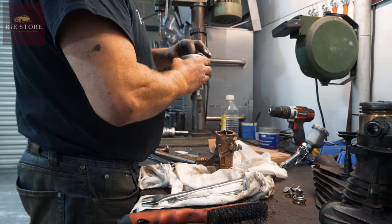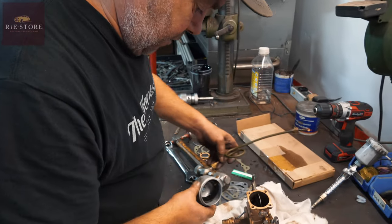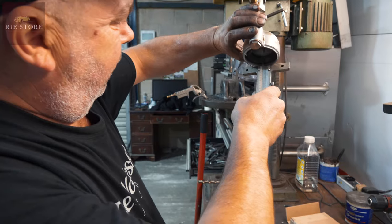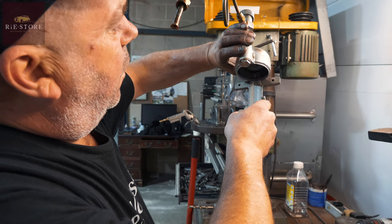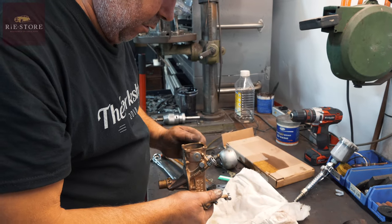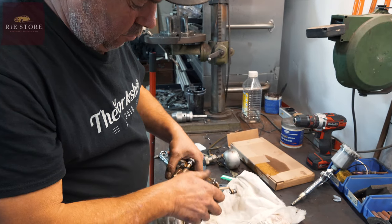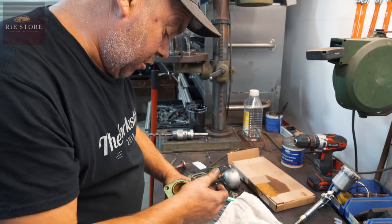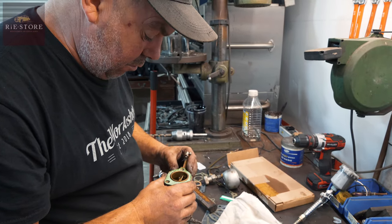Got a rubber ducky in there, so that's all right. Float level doesn't look too bad. A little bit low, so we'll bend him up a little bit. Base gasket's on. What do you check for normally? So like a list of things in your head that you're checking? Just anything that looks blocked or unseated properly, you know.